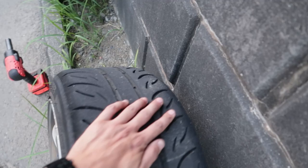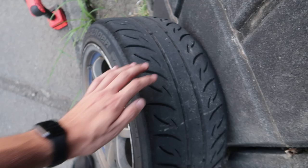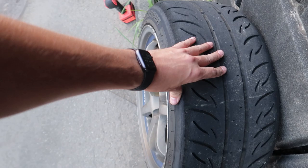See, this is what I'm talking about. See the camber wear just on the edge here? Hasn't split or separated the tire at all yet. It's the perfect time for me to flip these so that I can then use this meat here. Now, bear in mind, I'm not going to do another event on these. Like I said, these are literally just so that I can use them for driving and actually get my money's worth out of them. These things last forever.